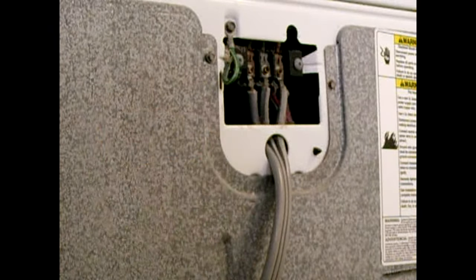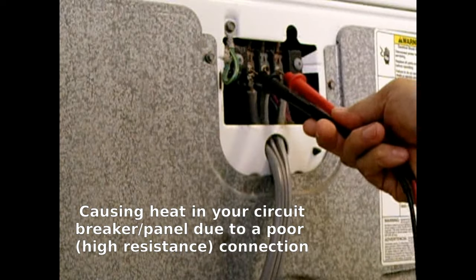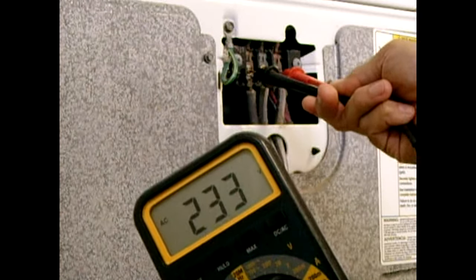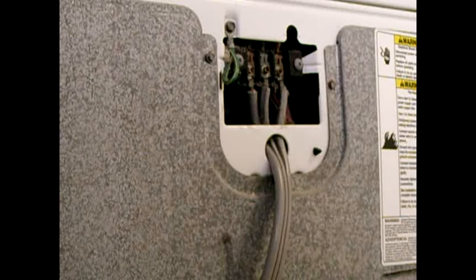There's always a chance the circuit breaker has a very high-resistance or corroded connection between the clip on the breaker and the bus bar on the panel. Once the heating element and motor come on — a heavy load — that weak connection can cause the 240 volts to drop way down. So take that voltage reading at 235–240V, then push the start button and make sure the voltage stays fairly high when the load comes on. If you see the voltage drop, that's a sign to check your circuit breaker.